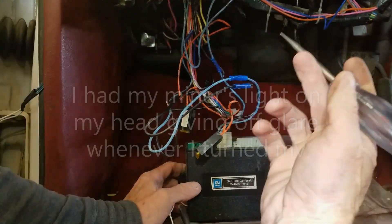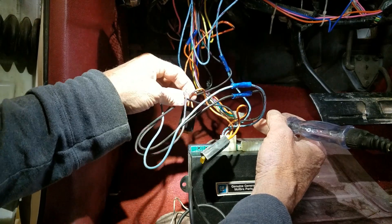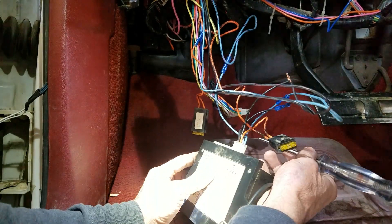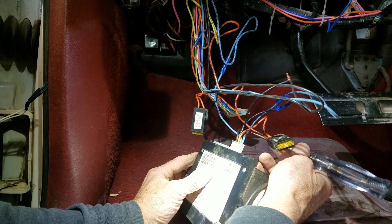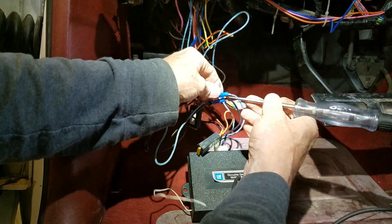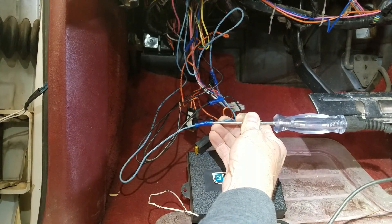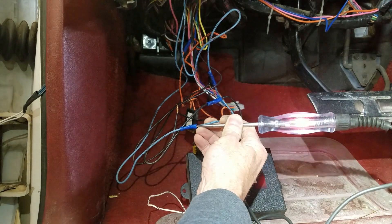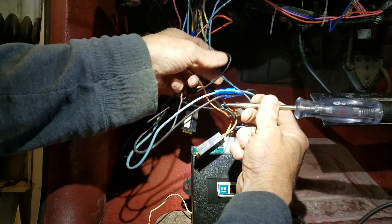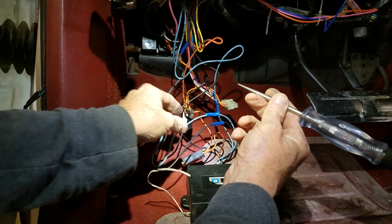Now I've got my test light and I reconnected this wire here temporarily. What I'm trying to do is figure out what wire does what. The back of the instructions say the light blue wire and the light blue with red wire are the lock switch and lock motor — one is up and one is down. I put this in there, hold it, hit the door lock switch on the door, and you can see the light coming on. That's locking. It doesn't do anything when I'm unlocking — so grab the other one. It's like they got them backwards.